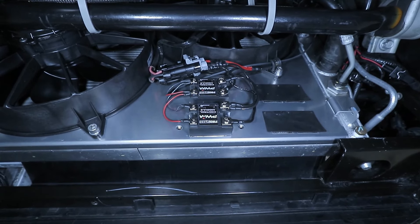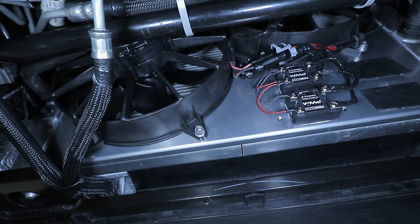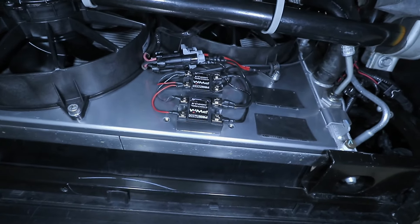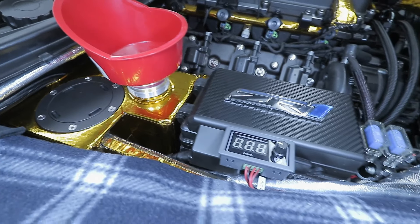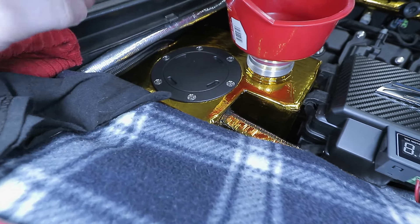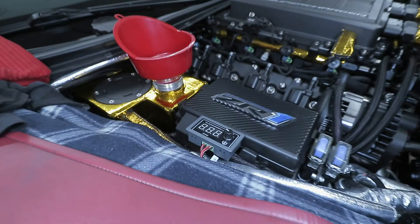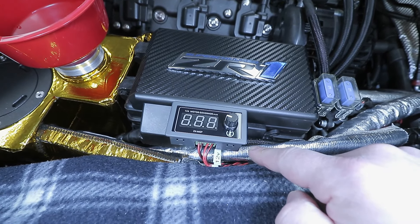One other thing I want to mention: the edges on the aluminum housing, the shroud, are very sharp. Be very careful — wear gloves, or like I did, deburr the whole aluminum shroud. I would have cut myself up really bad if I hadn't done that. I'm unhappy with the presentation of the shroud because it's basically a piece of stamped aluminum left very sharp with no deburring done for the end user. You shouldn't have to worry about cutting your hands open on a razor edge. Please deburr your fan shroud, ProSpeed.